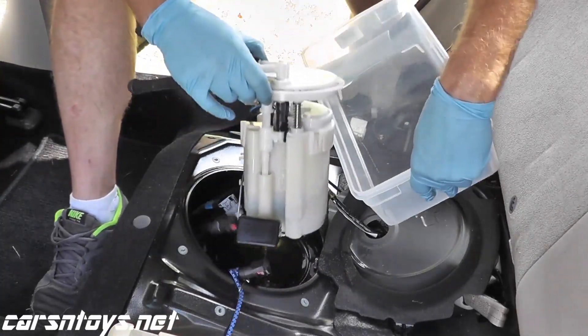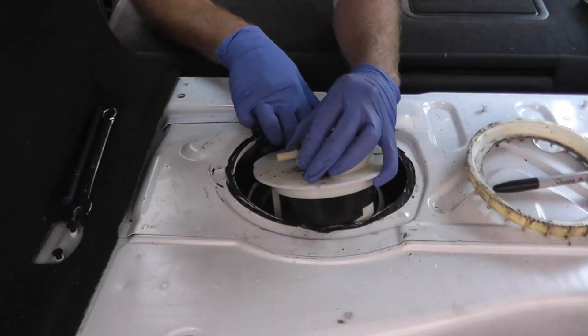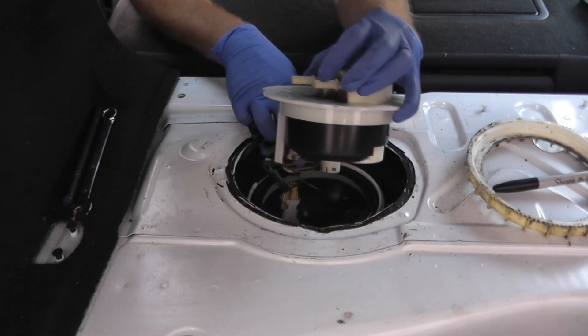If you do need to replace the fuel pump but you're hesitant tackling the job, I've done two prior videos on replacement — one on a Subaru with the pump under the rear seats, and one on the Audi. Ultimately it's pretty much the same for most vehicles: you have the access plate, harness connector, vent line, remove the pump from the tank, replace it, and you're ready to go. I hope this helps. Test everything — you can save a lot of money just by pinpointing where the problem is. Thank you for watching.